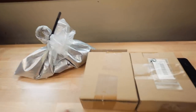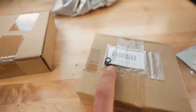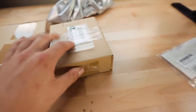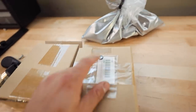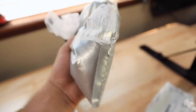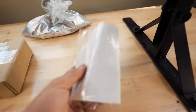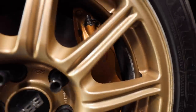Here's everything I have for the Brembo rebuild. I've got two rebuild kits. When you go to rebuild Brembos, they don't give you the small little o-rings — those have to be bought directly from Brembo. I got them from Fast WRX — I'll put a link in the description. Those o-rings are important because Brembo never intended for people to split the caliper case halves, so if you're doing that, you'll need these.